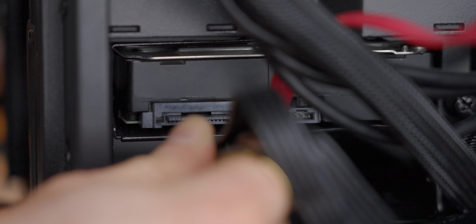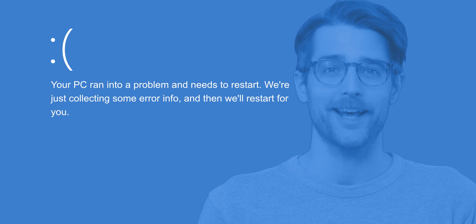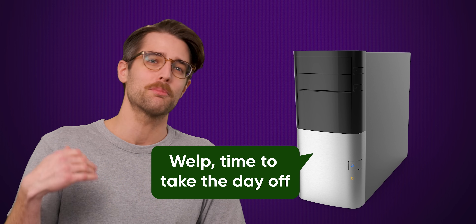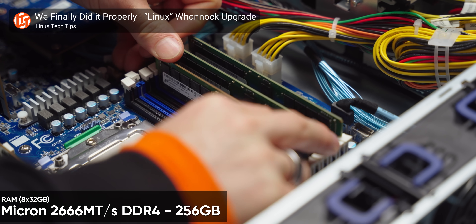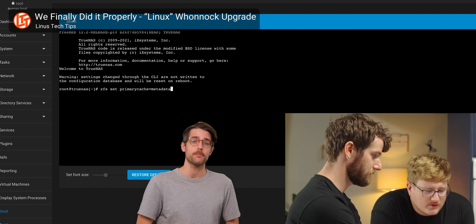If you remove an SSD or hard drive, what happens will depend on what kind of connection the drive was using and whether it was the drive you have your operating system installed on. Removing a non-OS drive typically isn't a big deal, though you run the risk of data corruption or loss if the drive was in the middle of writing something. If you pull your OS drive, you're going to be looking at a blue screen of death if you're running Windows, as it's frequently reading and writing to your main storage drive and will halt everything if the drive disappears. Linux is a little better at handling drive removals or failures and can be more easily run just from RAM, which makes sense considering Linux is a very popular server operating system where you want as much uptime as possible, even if a drive fails.